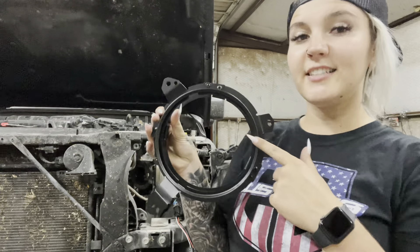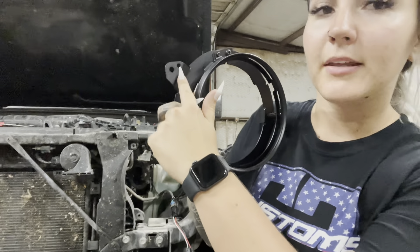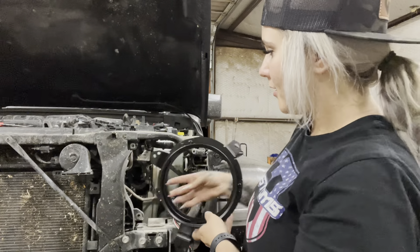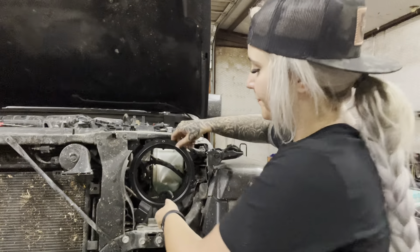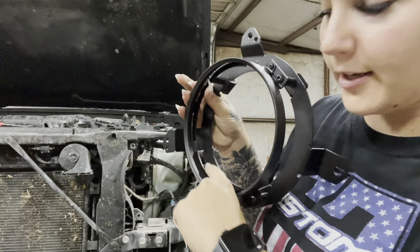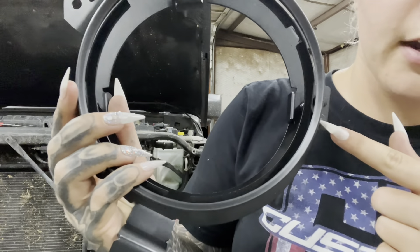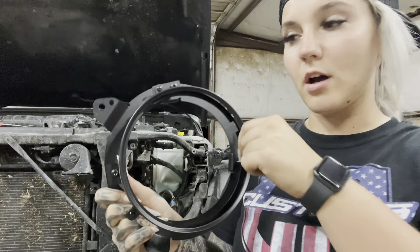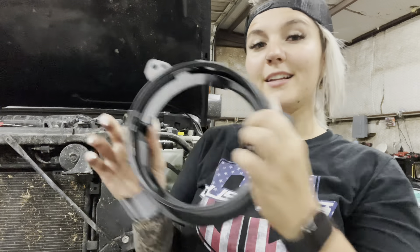Now you have the JT adapter mounts. If you notice on these, they have little notches right here and right here — those are the bolt holes and the little notches. I'm just going to mock this up to show you where it's going to mount: put it over those notches and boom, it fits right there. Your headlights are going to fit inside of this ring, so you have to take out this screw, this little guy right here, and this one right there so that the front plate will come off and you can install your headlight inside.